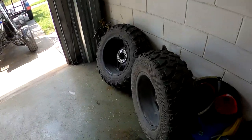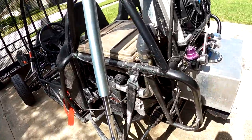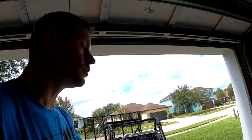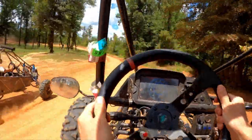You can't really control 330 horsepower in this thing — not at the wheel. I have pretty good tires but I need them beefier and wider, so I'm getting a wider tire in the back. We didn't break anything — absolutely nothing. I didn't push any coolant out during the entire run, and intake air temperatures were looking really good: about 110-115 degrees at idle for a long time, dropping to 100-105 during a pull. I could turn up fuel pressure a bit for a little more fuel across the board, but I don't want to detune the engine right before the trip — we'll mess with fueling after. Crank horsepower is about 375, which is how much power my 6,000-pound V8 truck makes. So that's pretty wild.